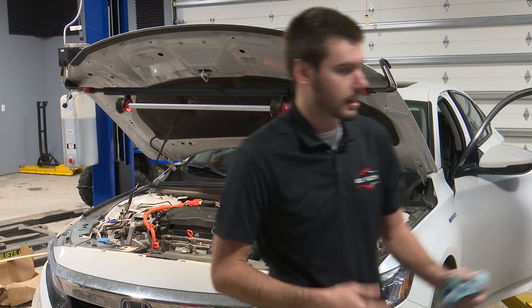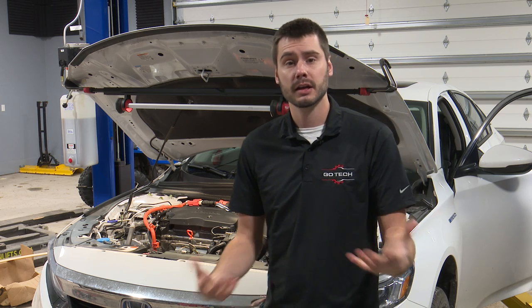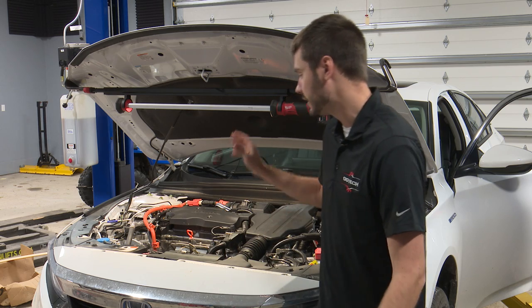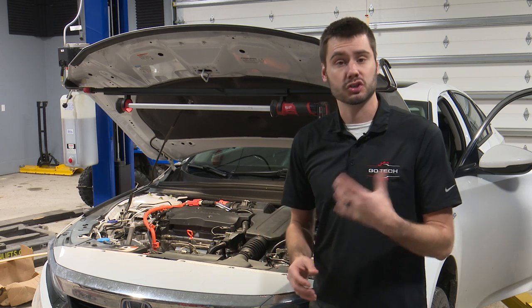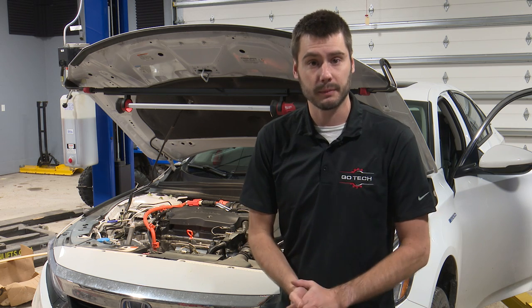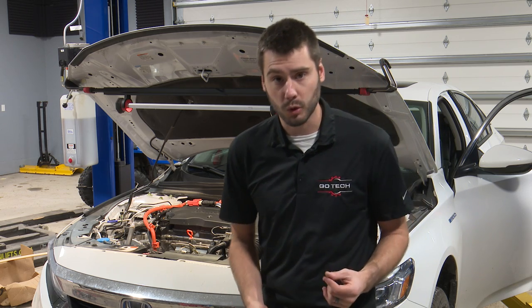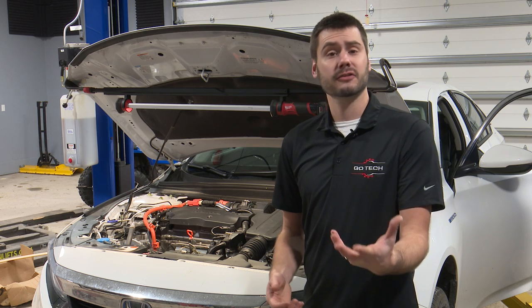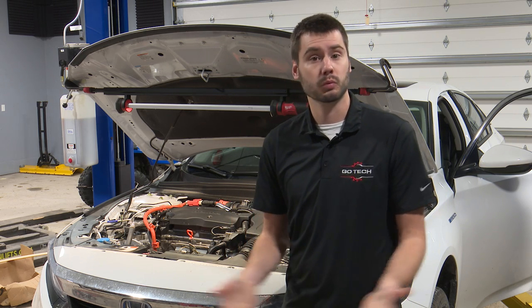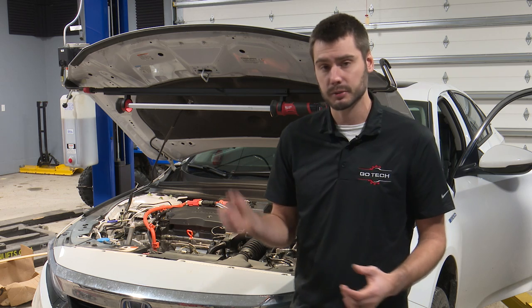Our oil change is done on our hybrid vehicle and nobody got hurt. There's nothing too crazy about working on a hybrid. Like I said earlier, 90% of repairs done on hybrids don't even involve the high voltage orange cable system. There are complexities to working on the high voltage system and there's training and many different ways to be cautious about that. But to do simple maintenance, you don't have to shy away from it. If you're a DIY-type person, a weekend warrior who likes to change your own oil, just because you own a hybrid doesn't mean you can't do that anymore. If you're a shop and you've been turning hybrid vehicles away, simple oil changes, brakes, suspension, tires — all of those things can be very easily done without even touching the hybrid system or pulling the safety plug.